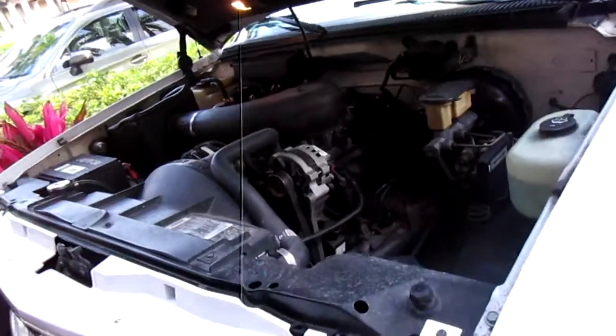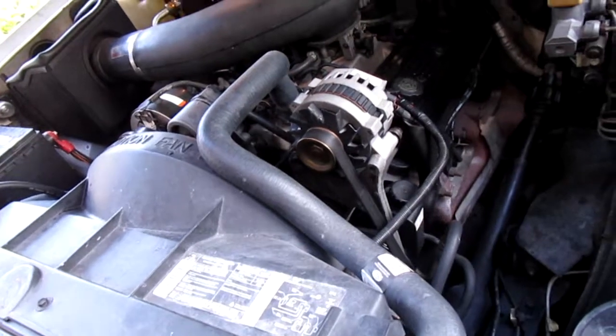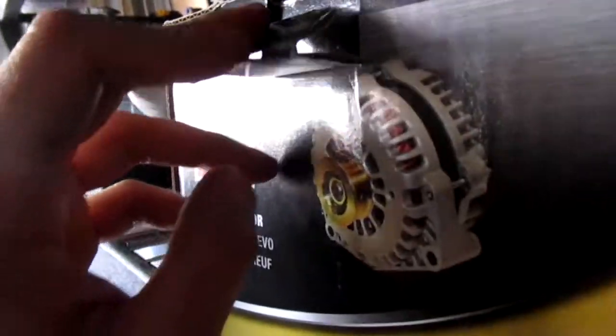So this alternator, I believe, is cooked and it's just not charging well. It's not completely dead, but half dead. Probably got a bad diode. But we're in luck because we have another alternator that's made in China. And guess what I paid for it? Nothing, because it came damaged and the company just said, oh, keep it. And then I used parts of another alternator I had and I kind of fixed it. It might work, it might not, I'm not sure.